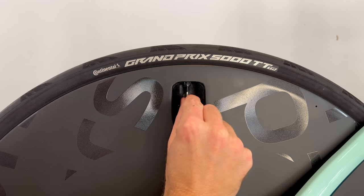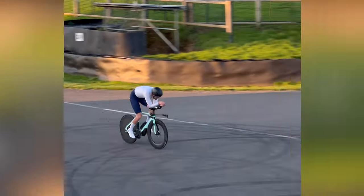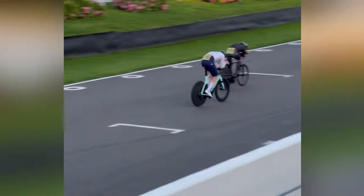To conclude, for my bike these wheels are nearly perfect. I love their wider design — the wider tyres make the bike noticeably more comfortable and they fit and suit my bike perfectly. Their price is also fantastic for what you get, and most importantly they are seriously fast wheels. The only two small gripes I have are the small space for the valve in the disc, and the front tyre blowing out to 30 millimetres. Even though it still sits within the rule of 105, I think 30mm is slightly too wide for the front wheel. If buying the disc alone, you can't go wrong here.